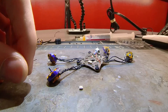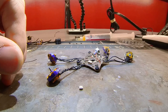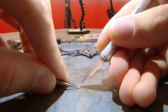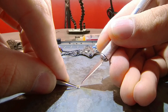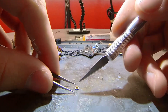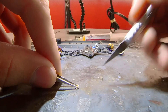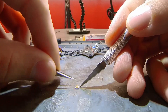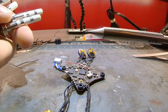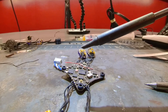The pads are tinned. They did melt a little bit. If they melted, you can fix that with an X-Acto knife or just some pointy tweezers and scrape away the melted parts. The reason this is necessary is because if these are melted on top of the connector, you can't make good contact with the soldering iron. So if you scrape away the melted portions, you can directly contact it. I also don't advise using a conical tip for this — what I like to use gives me the best thermal conductivity.